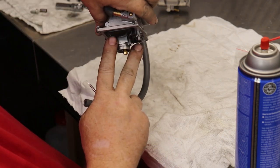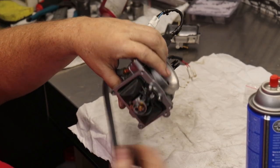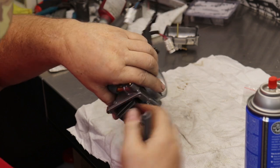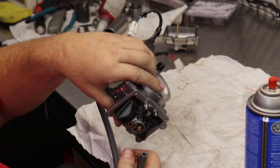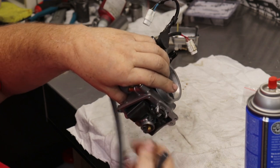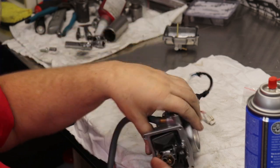There's a little tab inside you can adjust up or down depending on whether the floats are too far up or too low before it seats. You want the floats pretty much level — that's the best point I've found, because you want them as high as possible to keep as much gas in there. Some people set them too low and get air in their pocket when hitting bumps, which causes a lot of problems.